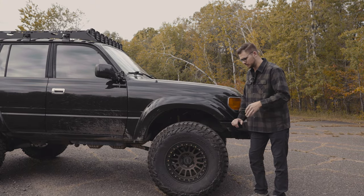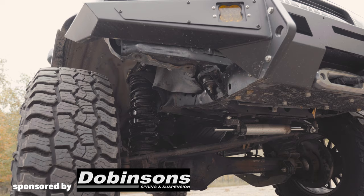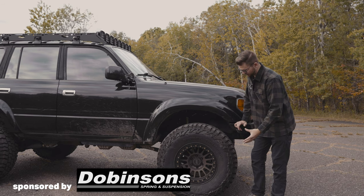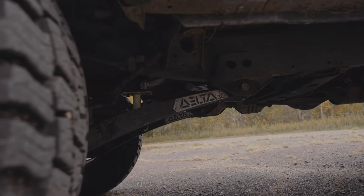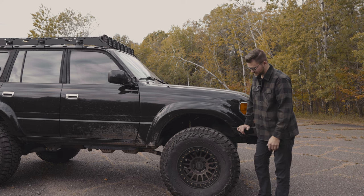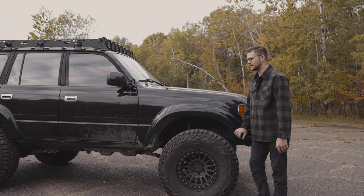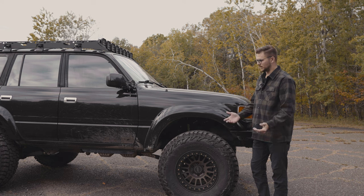The suspension is a little bit intricate. I'll put links in the description, but it's running a six-inch lift shock absorbers and three-and-a-half-inch lift dual-rate springs. We have the MRR front steering dampener and a bunch of other things to get everything to fit. The front radius arms are from Delta Vehicle Systems — their 3L version — which moves the axle forward a bit so you can clear 37s better. The front and rear are both locked — triple locked, actually, with a center locker too. The front locker was a little finicky, so we swapped it for an Eaton electronic locker. This is also re-geared to 5.29s, which is a little over-geared — ideally you'd run 38s, but 37s work just fine.